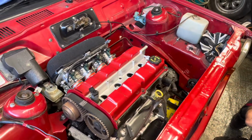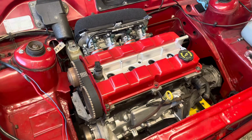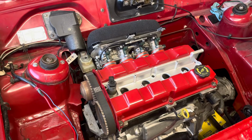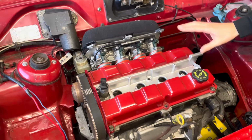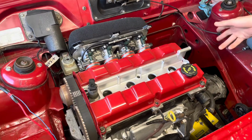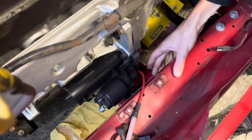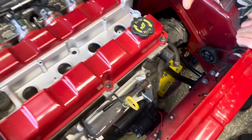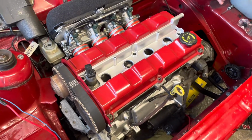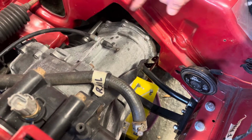Yeah, so talk us through this a little bit, Mitch. Yeah, so it's what you said, it's an ST170 engine on bike throttle bodies. Individual throttle bodies, yeah, which my dad's bought the kit for. We've had to do quite a lot of work to actually shoehorn it in. You've got these brackets here for the cradle, which slightly offsets the engine to fit in the bay. You've got custom drive shafts, a changed tie bar down there, and a strengthening bar as well because you have to cut out this section to allow the Mk2 XR2 gearbox in.